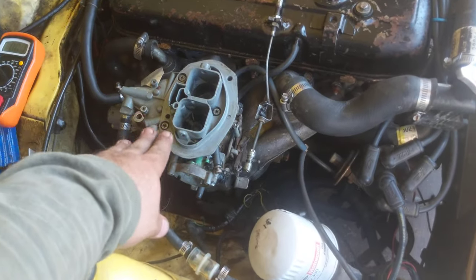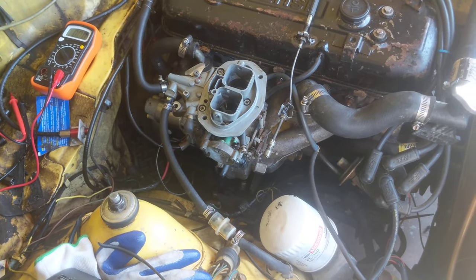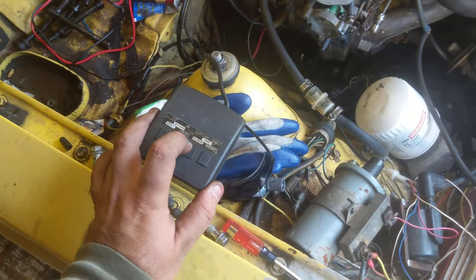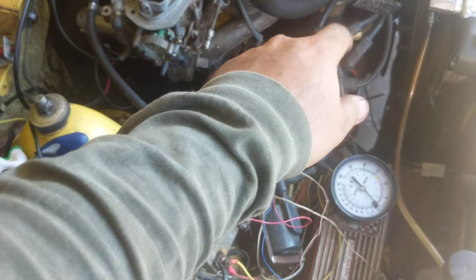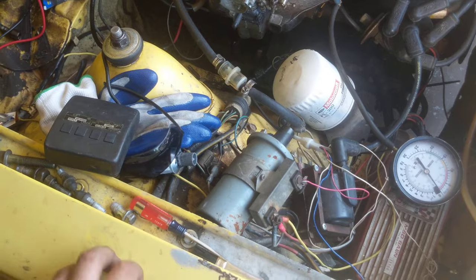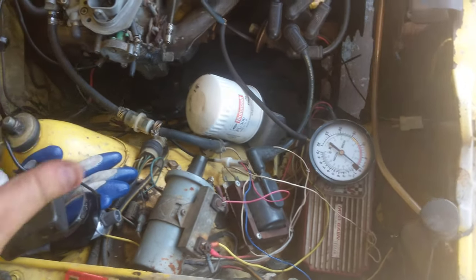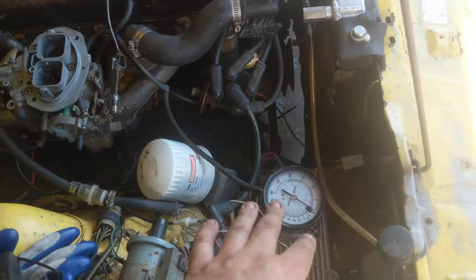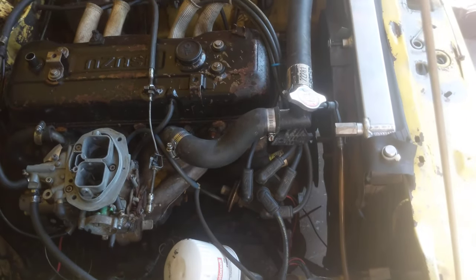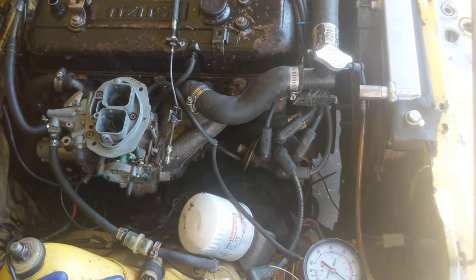There are two of them and I'm just playing with the idle, but I'm probably going to change the transition for the secondaries as well. This device comes in very handy because it gives you RPMs and also does the advance degree of the distributor, but only works on points and this doesn't have points anymore. It has a voltmeter and other stuff — they don't make this stuff anymore. So there you go — it's adjusted to its best vacuum, the transition circuit now works okayish. Let's see if it explodes at the next race or not. Hopefully not. I'm putting a lot of effort into making this thing run the way it's supposed to run.